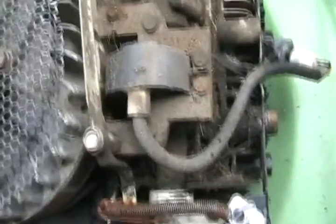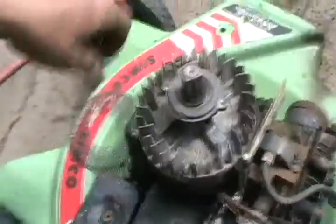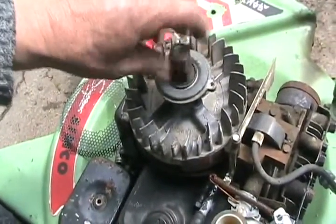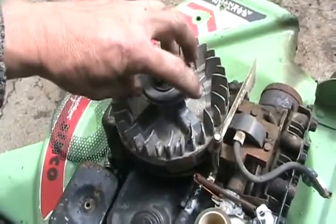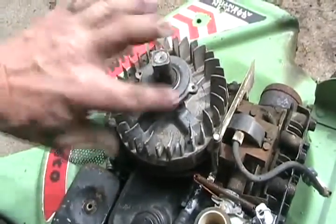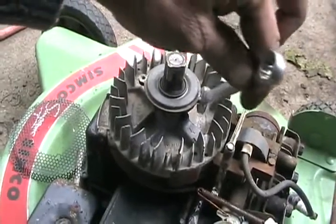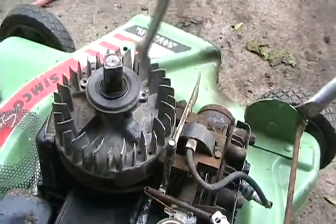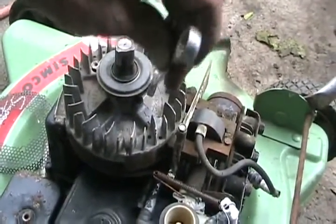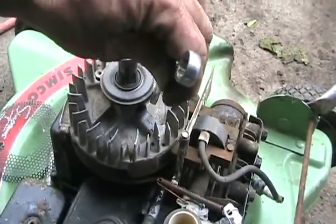Every time you take the cover off, look at all the crap in there and blow it out. First step: take off the screen, then feel that your ratchet shaft isn't seizing up — that feels good, although I always oil them anyway. Now there are two ways to get the flywheel nut off: one is to put the open end of a wrench against one of those screw humps, hold it at a bit of an angle, and hit it hard with a hammer in the direction it unscrews. You put one foot on the flywheel blades on the opposite side to stop it from rotating and it'll unscrew itself.